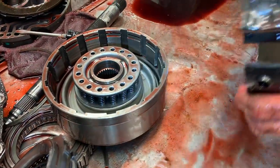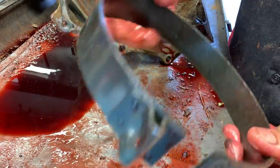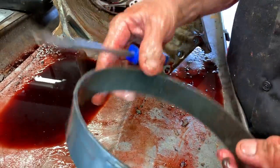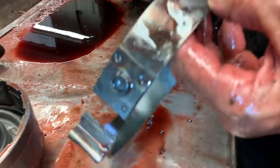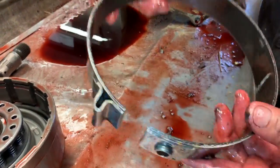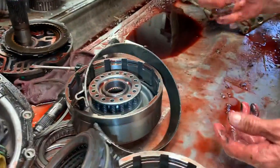The engine brake band is a lot bigger in the 4L80E than the 400, but this band will actually interchange. You don't want to put a 400 one in there because it's actually half the size. Most of the time when we do a tranny brake or anything like that, we throw this band away anyway and don't even use it. It's only for engine braking.